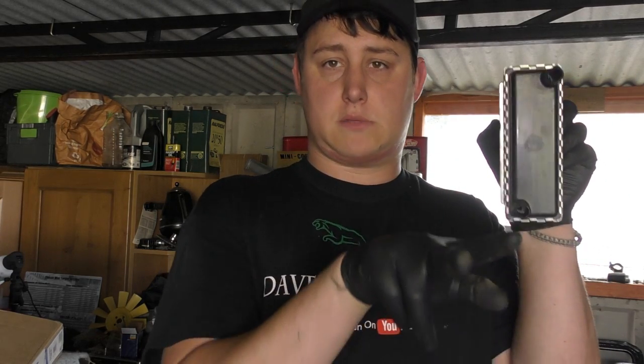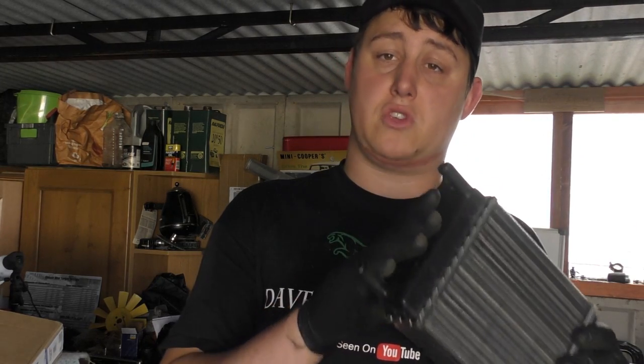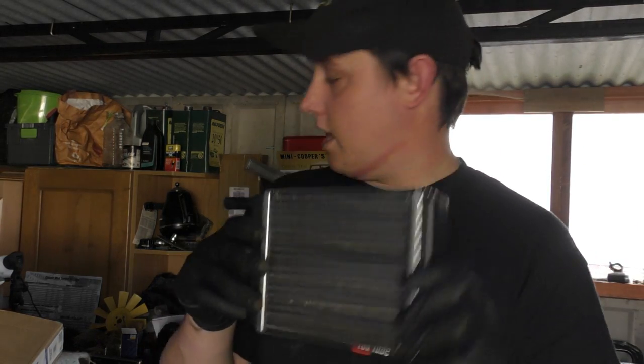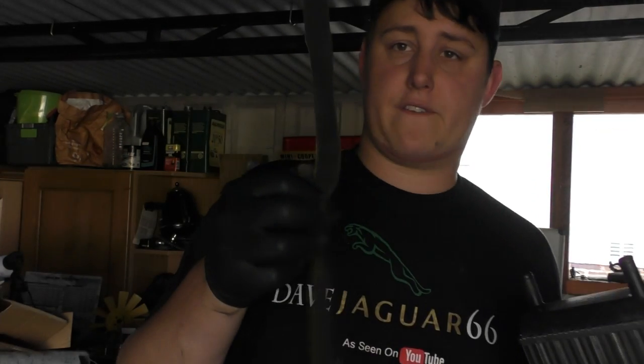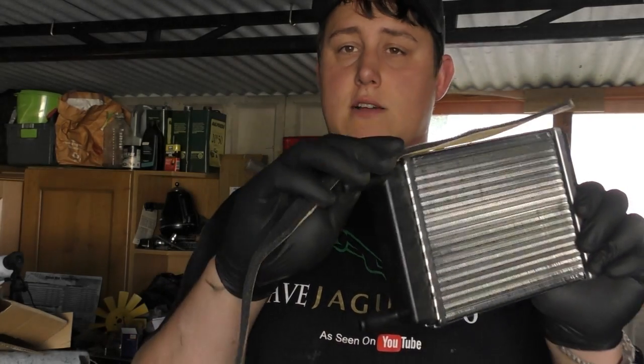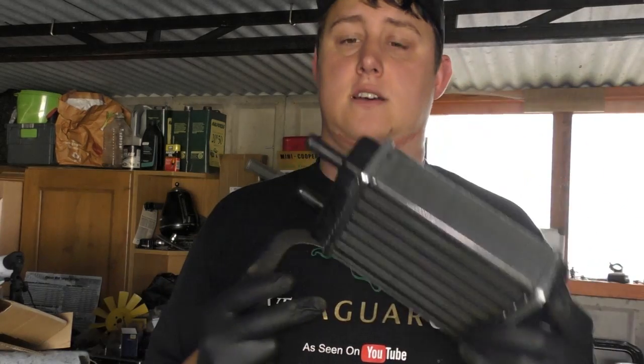It's got staggered spouts. Sometimes you have two by the side, sometimes you come out and then going up, sometimes they're a little bit the same side, so you need to make sure that if you're going to get a heater matrix, it's the right model for your car. As well, in the box somewhere there is a foam strip. Now the strip goes around the outside of the heater matrix to protect that from rattling around inside.